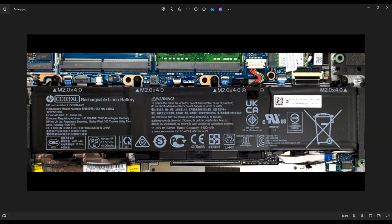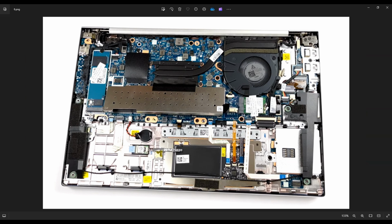Now, as with any wires in a computer, guys, try not to pull on the wires. Put your fingernails on either grip there, on that plug, or a pry tool, or a pair of pliers, or something other than pulling on wires if you can help it. And you can just jimmy that plug right out of that port. Okay, so after your battery has been removed or unplugged, we're safer to proceed into the computer now.